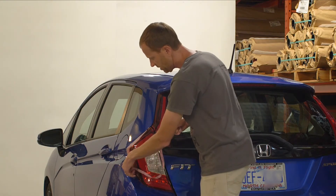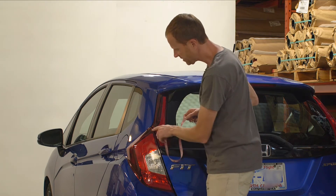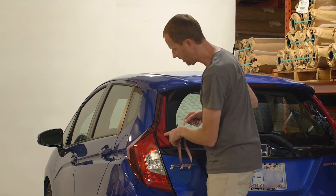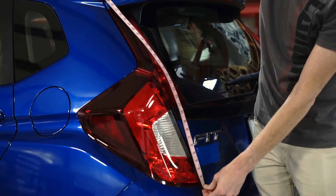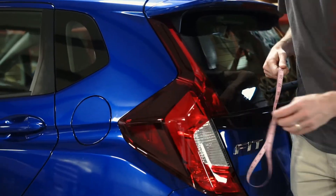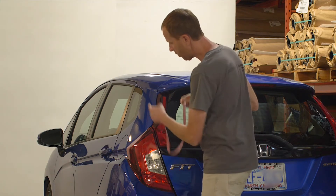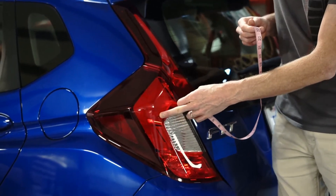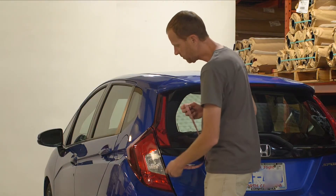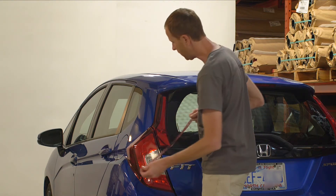So that's 14 inches by 20 inches, but we also have this other piece here that's separated — an inner light. It's not worth going the full length twice; then you'd have a lot of excessive Lamin-X and you'd be wasting money. What we can do instead is figure the size of this inner piece, add it to the size of the outer piece, and then cut that strip off — allowing for a much more efficient use of the film.